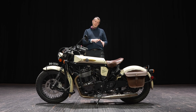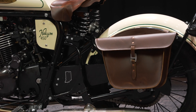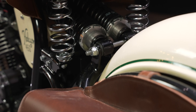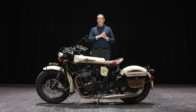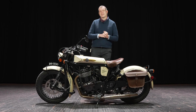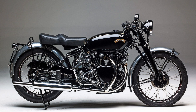The Halcyon 450 has rear suspension, unlike the 250. Rather than going with a simple trailing fork like on our Griffin and Phoenix, we really wanted to capture the beauty of the Halcyon and that geometry that makes it really distinctive looking. So we went back in history and looked through some of the different designs that have occurred over the years. The one that really captured our imagination was the Vincent cantilever suspension, developed by Phil Vincent with assistance by Phil Irving in the 1930s when they came out with their Rapide series.